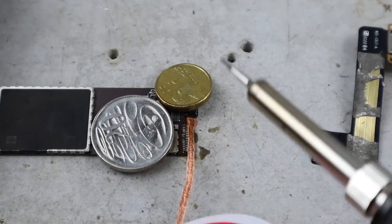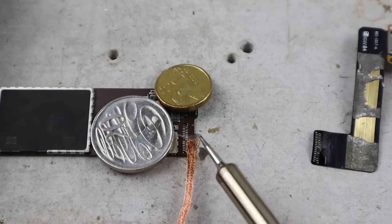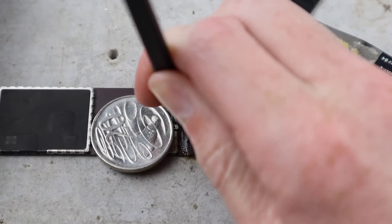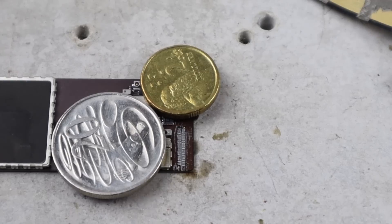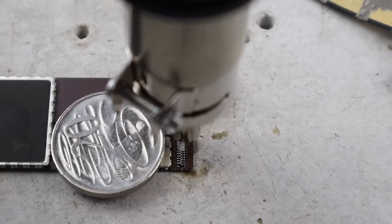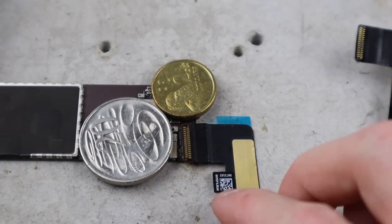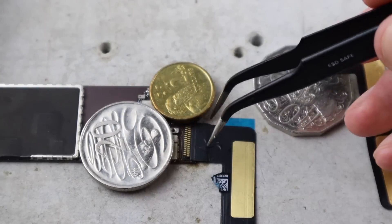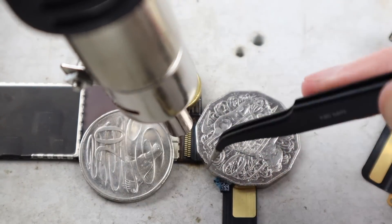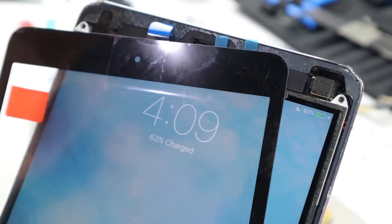I added some more flux and moved across to the soldering iron portion of my solder rework station and tried to remove the remaining solder with solder wick, however it's not a very good soldering iron. Moving along, I applied some solder paste being careful not to apply too much, then used a spudger to spread it out before coming along with the hot air — and after heating it up you can see it all group to its correct pads. If you apply too much solder you may bridge pads and have to use solder wick to desolder and start again. With some more flux added I repositioned the new dock connector and heated everything back up to solder it into place. I noticed I didn't solder it on very straight so I reheated it and lined it up better. Testing it out after letting it cool, sure enough the iPad is charging once again.